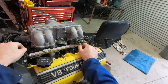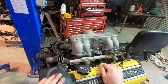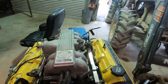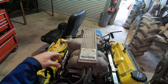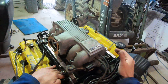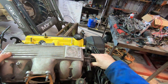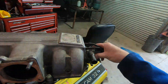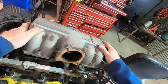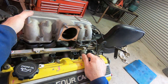Old Yeller is a Gen 1 engine. The dampener is on the left-hand side — I've done a video on the dampener. The throttle body is on the right-hand side. The fuel pressure regulator is at the front on the right-hand side, in front of the throttle body. Now, the lower manifolds can swap and the upper manifolds can swap. Let's start by swapping the upper manifold. We have a dampener in the way — I could probably fix it with a grinder, take off the corner.